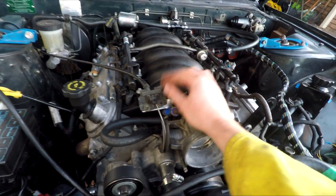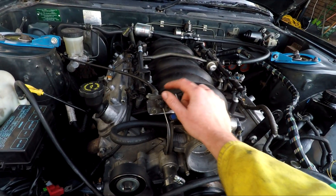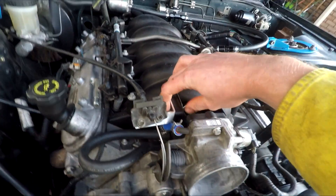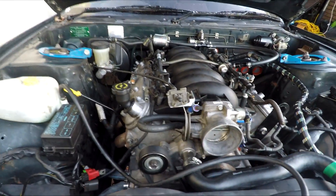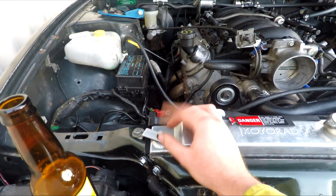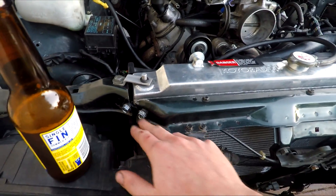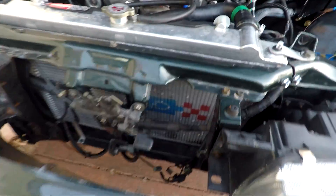For the throttle I've just run the S13 cable - it's probably not ideal, could be a little bit longer. I'll try to find one off a Skyline or something with a bit of extra length. I've made an aluminium adapter that bolts on where the throttle goes on the LS - it is at a bit of an angle but I've tested it and it works fine. For the radiator I've put some rubber grommets in so it's isolated and won't have electrolysis, which apparently happens if it's solid mounted. I've painted up the brackets and used new bolts.